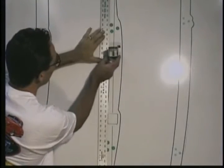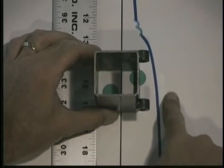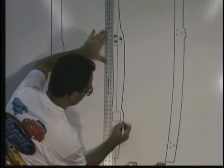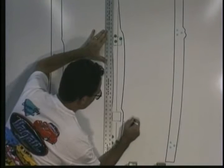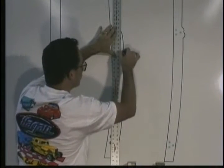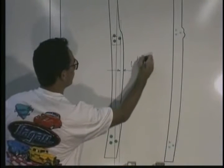Next, select a position at the top. The top pin loop sets against the outside panel on this setup. Both receivers must set flush against a straight edge. The minimum distance between the receiver tube and the outside of the body is 5/8 of an inch. Now draw a line connecting the outside edges of the receivers. The maximum distance between this line and the outside of the body is 1 and 1/4 inch.